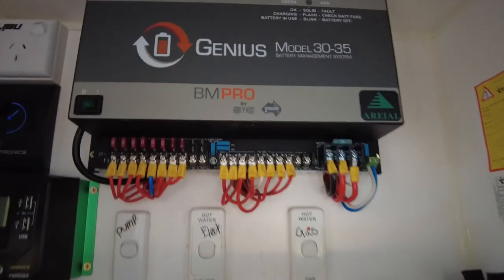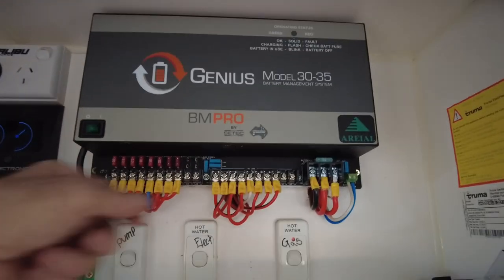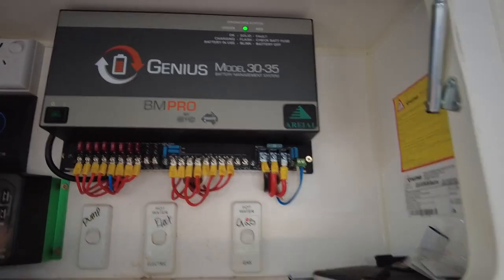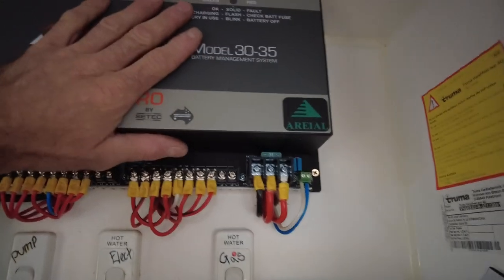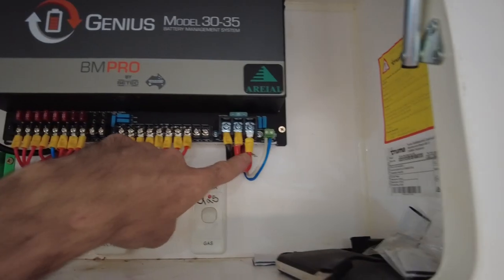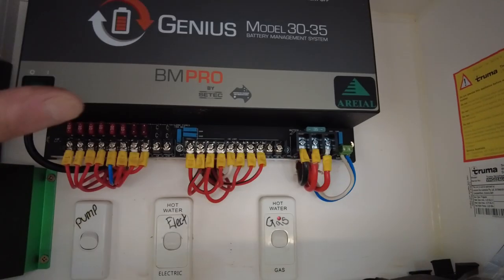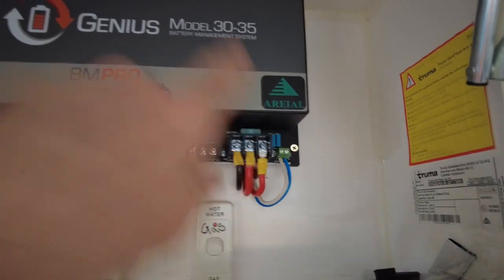Up here we have the original system kept in place — it's been completely disabled and that'll come straight off. This BM Pro is no longer used as a charger. Mains is not plugged in anymore because that would be running from the inverter, which has a charger built in. The mains lead for this is completely tucked away with zero potential to ever be plugged in again. If these guys sell the van and revert to factory, it's a simple pull-out and plug back in, reinstate the batteries outside, and you're done. No more charge rates go through it — no more solar, no more auxiliary input from the vehicle. The Redarc 50 takes care of that. This is now basically just a remotely-switched fuse box drawing from the 10 kilowatt hour battery system at 12 volts.